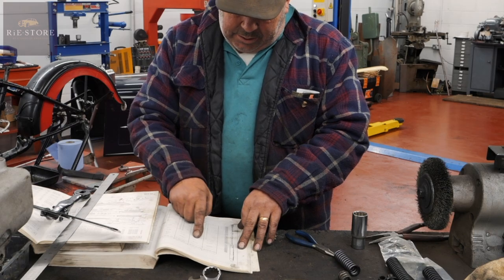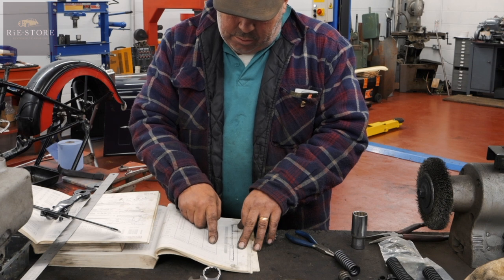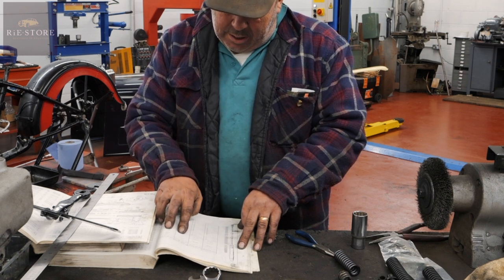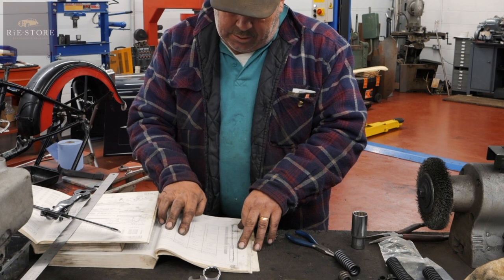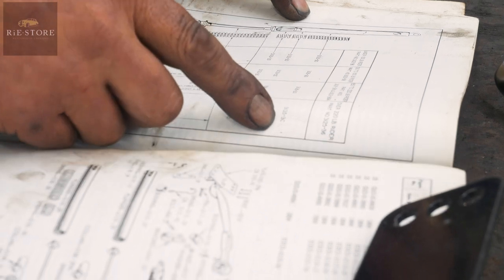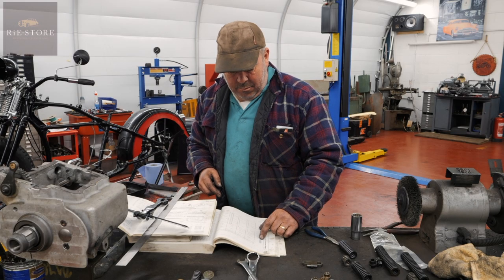Okay. And then on your top rebound springs, bottom one's exactly the same all the way through, middle one until you get to 150 to 220 pound, they go up a rate by the looks of it, and your top spring is the same all the way through. It's basically, it's only two springs you change, that middle one there and that middle one there.